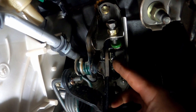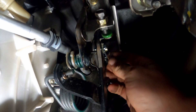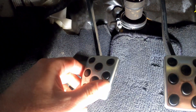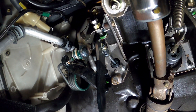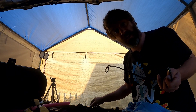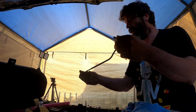I need to set up this pedal. The pin you put through, you have to rotate so that it doesn't connect with this end piece, and after that it just goes straight in. I think I adjust this by rotating the shaft until I'm happy with the slop, then do up the locking nut. Now it actually rotates really nicely, so that will work.